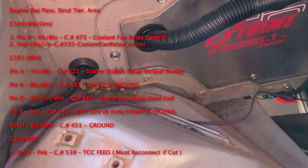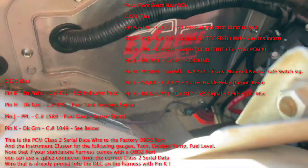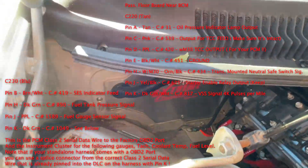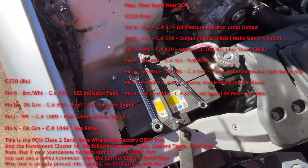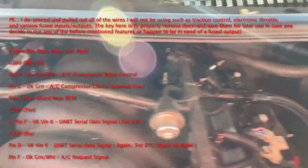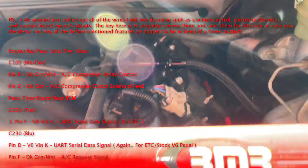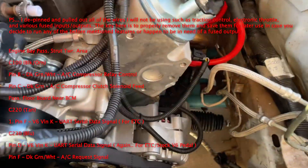Basically that's going to be it guys — the three plugs in the engine bay and the two small plugs which are C230 and C220 inside of the passenger side. Those five plugs are what it's going to take to get this swap running. Hopefully you buy a good standalone with instructions like I did, so it makes it easy. With the pin-outs along with the instructions from the standalone harness that you should order — I'll also put a link in the description for the one I got — you should be able to wire this car together and drive it.